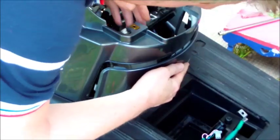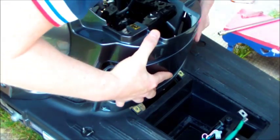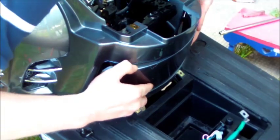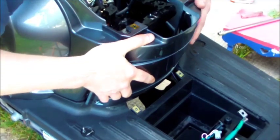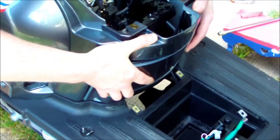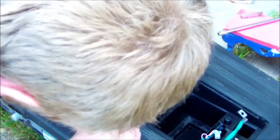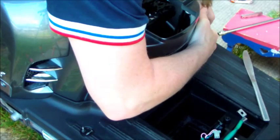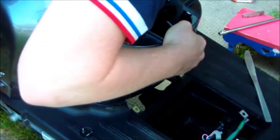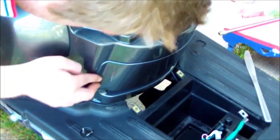Of course the body panel — I started with the middle clip to put it back on. I put my fingers in the hole in the front and then put my thumbs up top and kind of squeeze. I got the left side first — it kind of clicks into place sooner than the right side. For the right side I had to use a butter knife to kind of bend it inward. The bottom clip on the other side still wasn't in, so I lift it up and pushed in. With a little bit of strength, everything is nice and flush. Return the Phillips screws.